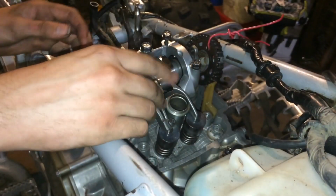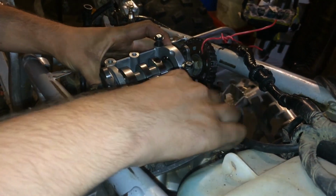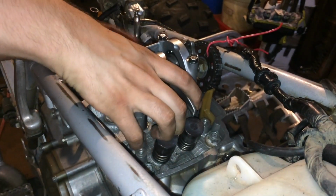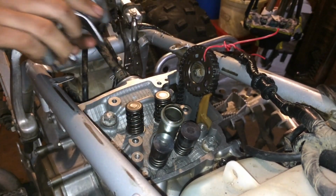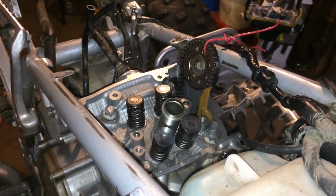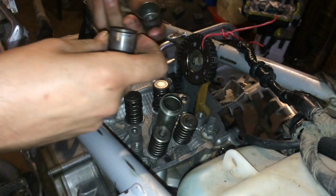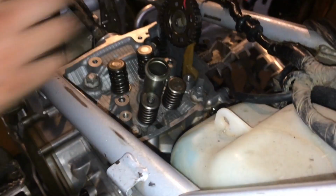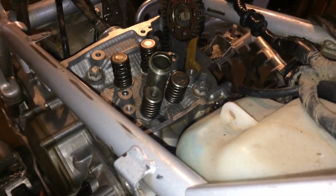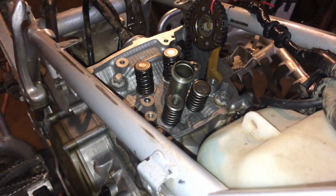This didn't fall down in the crankcase, right? Exactly. Okay, take that off. Watch my buckets down there. Make sure I'm not taking shims with me. Okay, I got both my shims there. Ooh, I lost both of them, but they're both right here, still in the head, so we're good. As long as they're not down in the crankcase, rattling around, tearing up rod bearings and stuff.